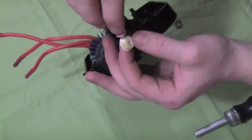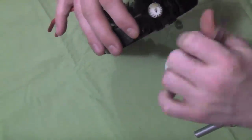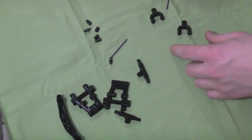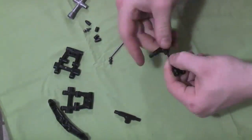Drop one of the plastic gears with grease onto the main shaft and grease up the diff, then slide that in. These are the upper A-arms — control arms — put those together.